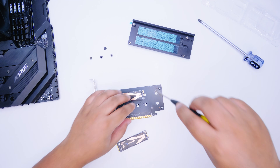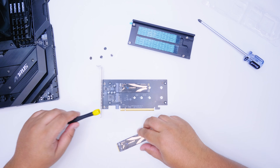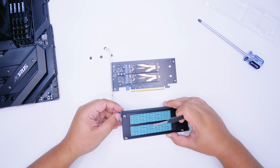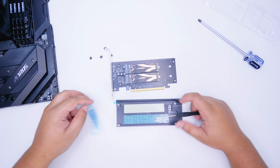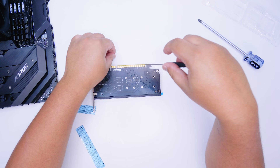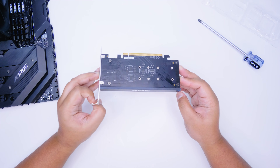You're probably wondering why I'm putting in two drives — am I going to do RAID 0 or something? No. I just want to be able to pull the drives out if needed without having to remove all the armor on top of these Aorus boards. There's just too much to get through. With this Aorus card, I can undo one screw, pull the whole card out, and pull a couple screws — it actually saves time. The way this works is with bifurcation in the BIOS: you split a PCIe slot in half or by four, giving you access to multiple drives on a single slot.